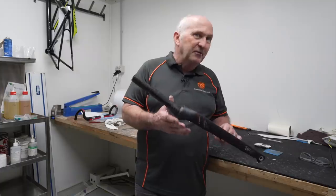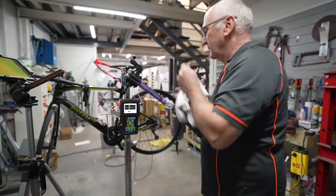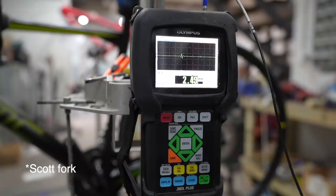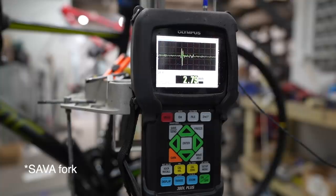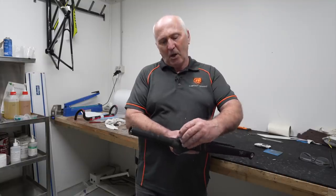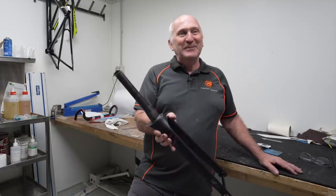Is it going to break on your next ride? I don't think so. But does it pass ultrasound? No — we looked at it on ultrasound versus a Scott fork downstairs, and the Scott fork was way more consistent with readings, while this one is all over the place. When it's inconsistent, I don't see any carbon that never has voids in it — but this one is wall to wall where I can't get readings. You get front wall, back wall at maybe 2.5 millimetres, but it wasn't consistently that. All over the place, and then I couldn't get a reading, which tells me there's a void in the middle. And up here it was reading 3 millimetres then half a millimetre, which would suggest a void between this carbon and the tube underneath.